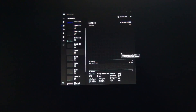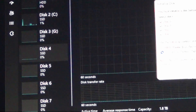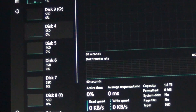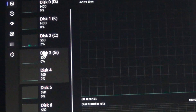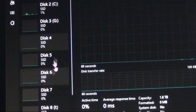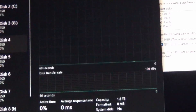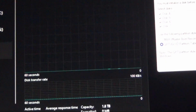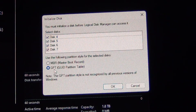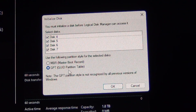So now we're going to open Disk Manager. We've got four new drives as expected — all four appeared. None of them have letters assigned. The existing drives — disk zero, one, two, three — all have letters already. My new ones on the NVMe card are disk four, five, six, and seven, all identical CT2000P3 Crucial two-terabyte P3s. Now we want to initialize all four of them using GPT. You do not want to use MBR — that's a legacy technology from the Windows XP era, long since replaced by GPT. So we're going to use the GPT partition table and click OK.